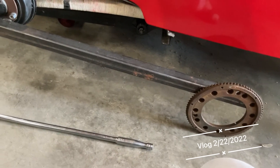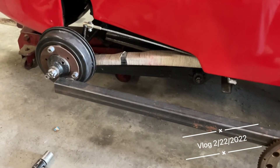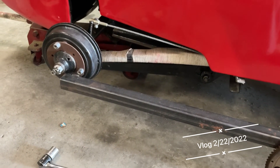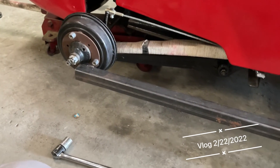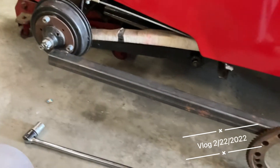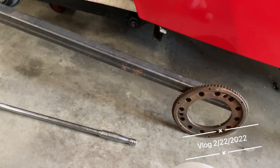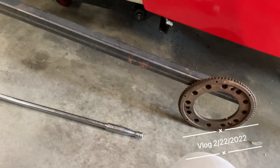I use the same spanner when I'm doing up the one on the flywheel. It's a very useful tool — it's made with a plate with three holes to fit the wheel studs, and then a long bar of square tube which is welded onto a flywheel pressure plate. It's a dud one, but it's got the right fittings and everything, so it's okay.